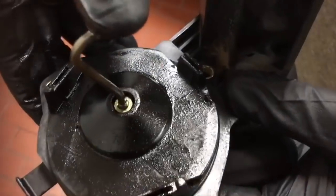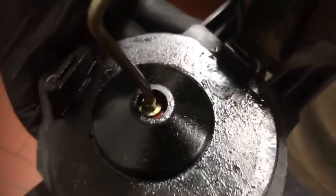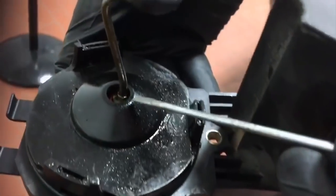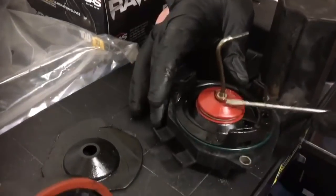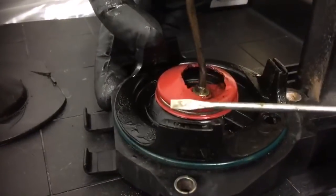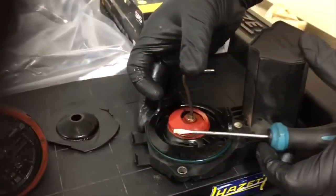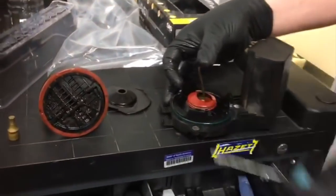Could you show the up and down? Down in here is where it rips. You see an orange diaphragm that's got a rip in it. So this is the diaphragm that rips. And once this rips, your vacuum can't actuate this. Oh, wow. That is a serious vacuum leak right there. Yep. And then you lose DISA and you get a vacuum leak.